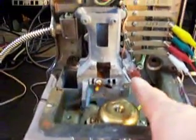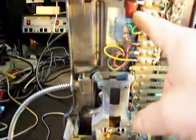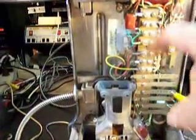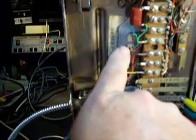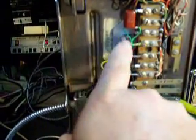Our bell is installed, and some of the electronics that it takes to make the bell work. We've gone down the screw down block and made all of our connections. We've installed a modular port jack at the back of the phone inside here, so it points out the back of the phone. I'll show you here real quick. So now you can simply come up and put in a line cord. You can plug any line cord you want into it now. So that's taken care of.